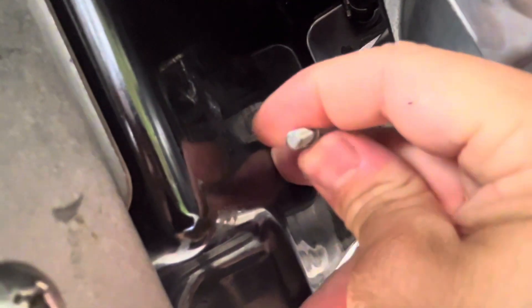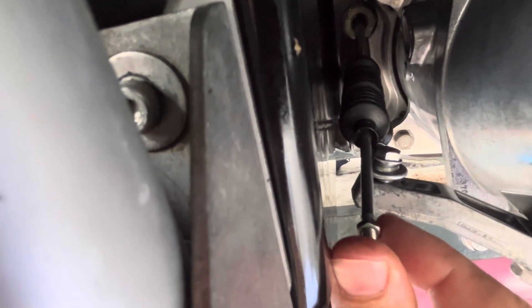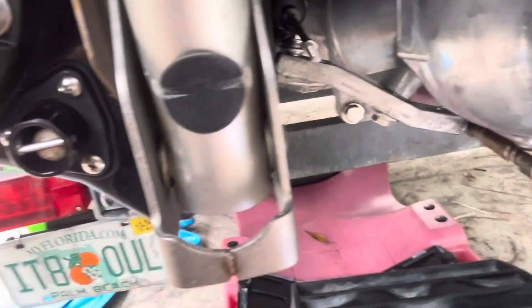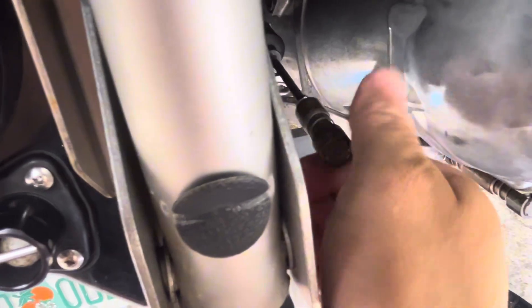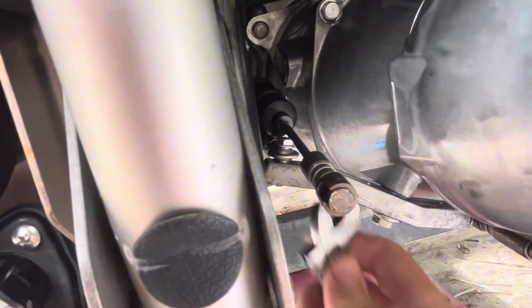You're going to have to make sure that the nut here is all the way back on this threaded shaft. You can see there are some threads — tighten this nut all the way to the back till it stops. Then here's our little quick connect fitting. Put a little bit of Loctite on this, and then screw this on all the way. Reach around and make sure that nut is cinched against this. Now that you've ensured it's bottomed out on that cable, reinstall the ride plate.